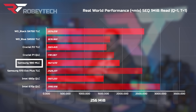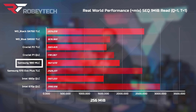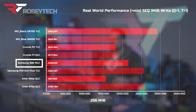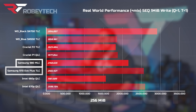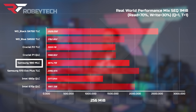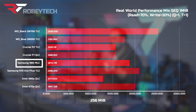The first charts we're going to look at are real-world results — basically single queue, single thread. What I mean by single queue single thread is a single application making one or two calls at low queue depth. These are things like PowerPoint, Word, or playing games — real-world scenarios most of us use our PCs for. In this category, the top three drives are the Intel 670p, the 970 Evo Plus, and the SN750, all of which have DRAM. But when you compare the 980 against drives it's directly competing with — like the SN550 and Crucial drives — it's basically at the top of that group, which is where you'd expect Samsung to be.